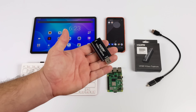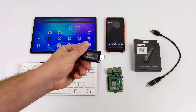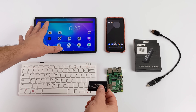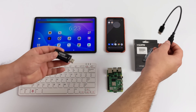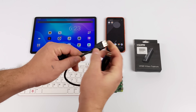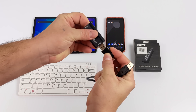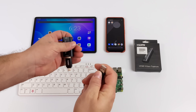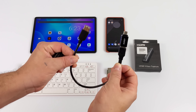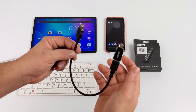Basically, what's going to happen is we're going to put HDMI out from the Raspberry Pi into the USB capture device, and in turn it's going to send that signal over USB to our tablet. Now since this has USB Type-A on one side, it's not going to plug directly into the tablet or phone, so I would recommend getting something like this — female USB on one side, USB Type-C on the other. I originally wanted to go with a smaller design but I didn't like the capture device hanging off the side, so I got a little extension: USB Type-C on one end, female USB on the other. I'm going to show you how this works from the Raspberry Pi 4 to my phone, and then we'll swap over to the Raspberry Pi 400 and the bigger screen tablet.